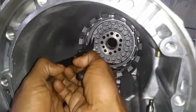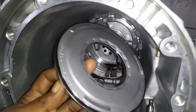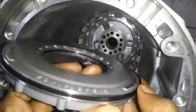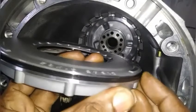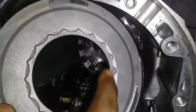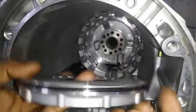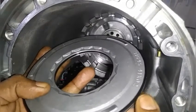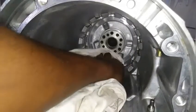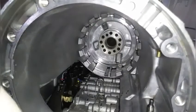Pull on the side, walking the piston forward, and this is it removed. This is the only piston inside the transmission. When you look at the seal, it has a lip, so that lip is folding out. On the inside is what's called a D-ring — it's a rubber seal — and on the outside is an oil seal with a lip to it. That lip folds out. Always clean the fluid; all the parts will need cleaning in a wash sink, a machine shop wash sink.